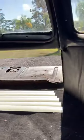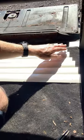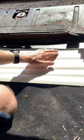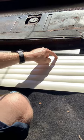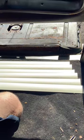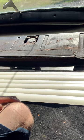Okay, now the blinds themselves. I laid them out here. They are different sizes, you can see here. I have them in order. At this end, I have them all lined up flush, and over here they're all a 1/2 inch difference. They start at like 38.5 and go up in 1/2 inch increments from there. The shortest one, at the top, is your top blind. So we'll go ahead and start sticking those in from top to bottom, and see how it fits and comes out. I might have to trim them, not sure yet.